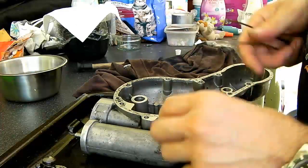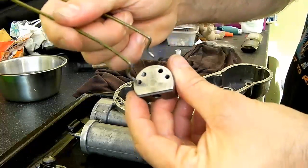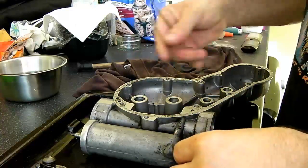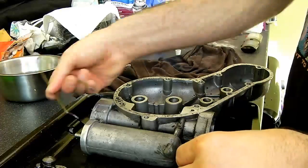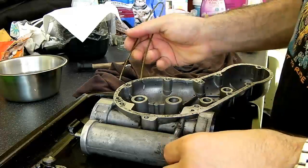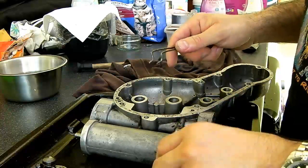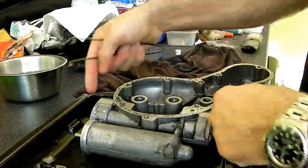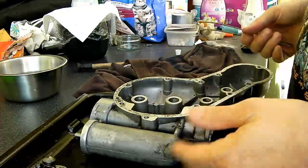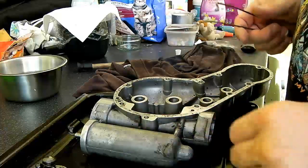And once that's done, it'll be a really good clear out with some WD-40 and degreaser, especially through all the oil ways here, especially these two in the middle which go into the plunger hole, through there, and then a very good clean out of the entire timing case and all the oil ways in here inside the oil filter, and basically the quill bolt, and anywhere where there's an oil way is going to get very thoroughly blown out with compressed air from the compressor. This is something that's essential, a really good degreaser, blow everything out with compressed air, and then it's just a case of re-oiling everything and reassembling the whole oil pump, spindle and everything else, and the end pieces, making sure that you reassemble with plenty of oil. And then of course once you fill the timing chest with oil upon reassembly, that will work its way in there as well, and it should be good for pumping oil straight away.